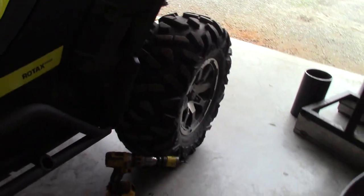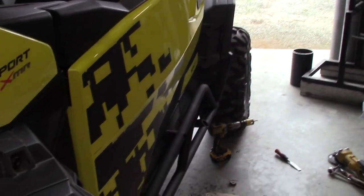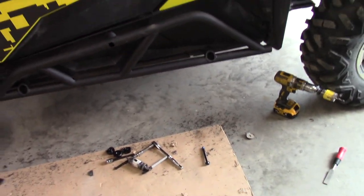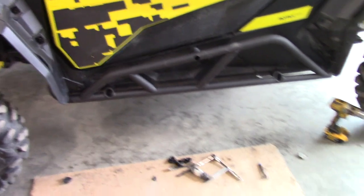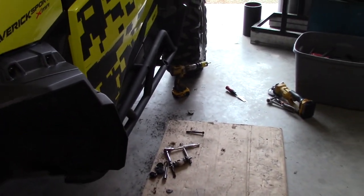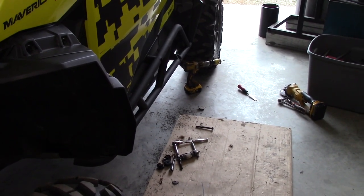If you had inch and three-quarter, there'd be about a sixteenth showing around the hole, which wouldn't be a big deal. I just like to stay tight — I used the hole saw on a slight angle just to ream it out a tiny bit for a nice tight fit. As you can see here, this more than likely wouldn't have been cracked and bashed off while we were riding if the sliders had been on. Possible still — if it hit up higher and punched it, yes, it can still do that. But just to rub along things and not worry about it, it'll definitely cause a lot less issues.